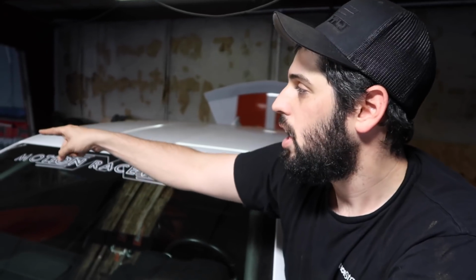So, also, on that, in yesterday's video I put a comment down saying that there were some push rod issues, rocker arm issues. That has been alleviated. When you guys heard the car running, it was on 4 cylinders with a bad miss. All that valve train noise was 2 bad push rods and 2 bad rocker arms. Swapped that all over. Ben's been grinding on that all day. Got that thing hammered up. Now it's just leaking out horsepower.